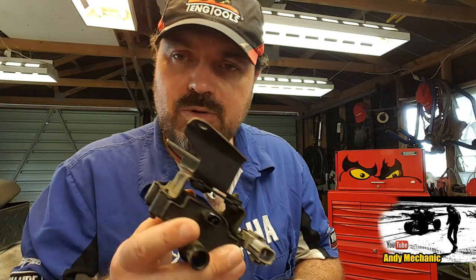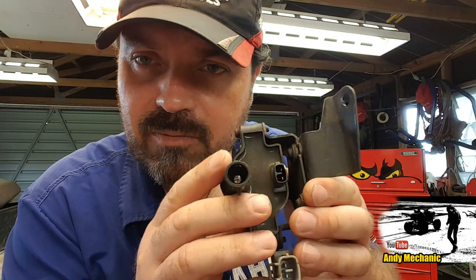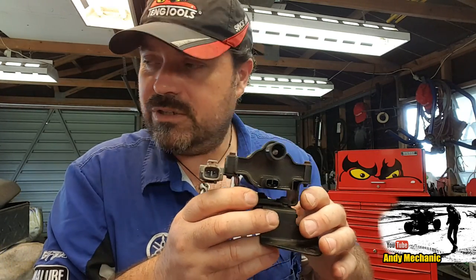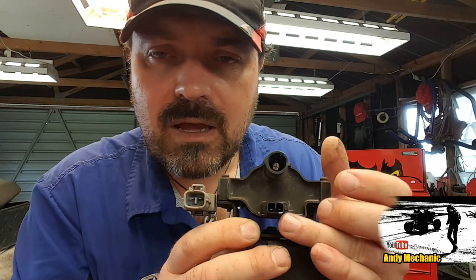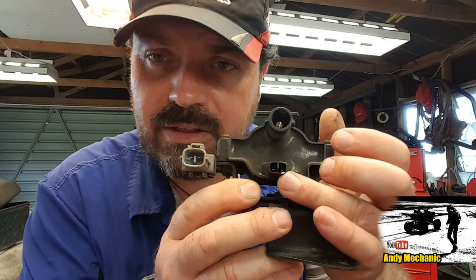Because there's a lot more turns, it induces a much higher voltage into that winding. And that's why we get 80,000 volts or more sometimes coming out on the spark plug wires — the HT leads to the spark plugs — but we're only putting 12 volts in. As we go out testing these things, we've got what we call the low-tension side, that's the primary winding, and that's these two connectors just here. I've marked a little yellow marker on this one — which is the positive side — and that will become apparent when we test the secondary winding.